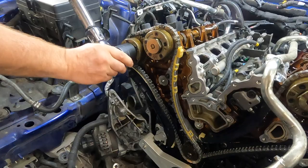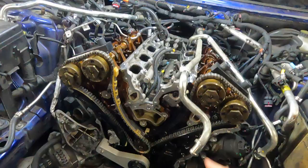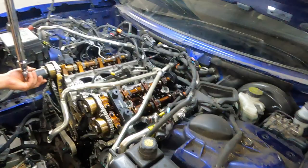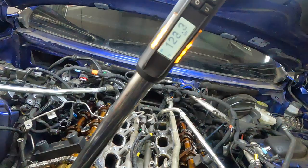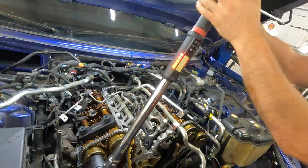And you also, guys, you start first from the intake on this side, and on that side you start from the exhaust, just straight the chain to start work tension there. Okay, let's finish. Yeah, you want to finish. Okay, 150 newtons is a good torque. You're done, you're good. A little bit over torque, but it's not nothing crazy.